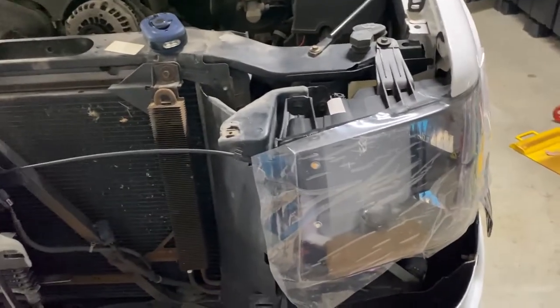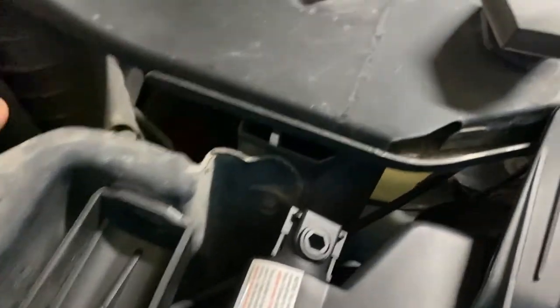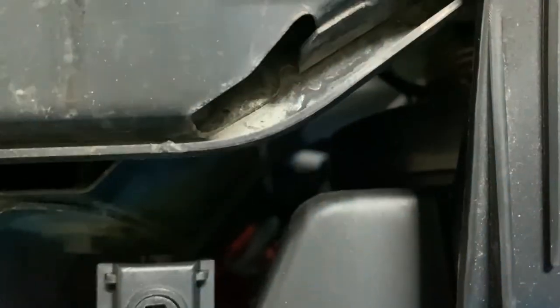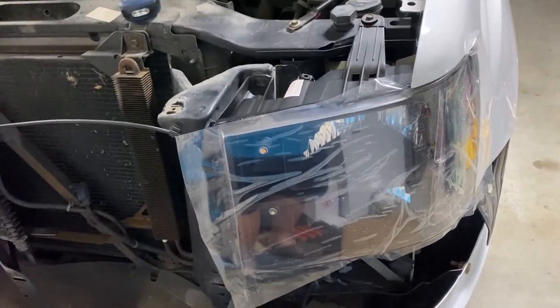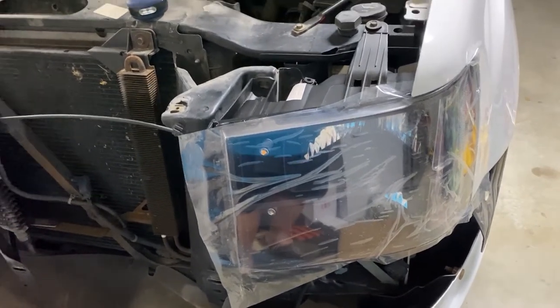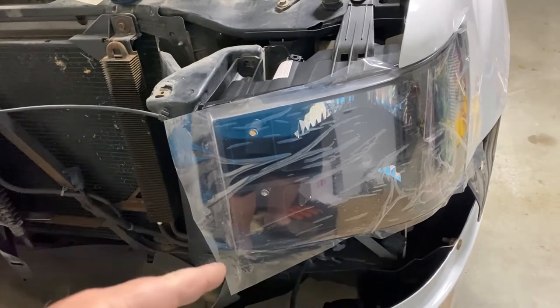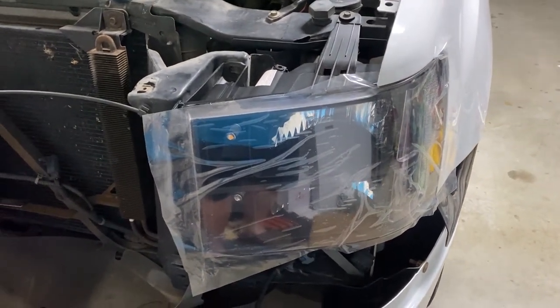I've got this in — it did not hyperflash. Before I do anything else, I mount my headlight in and then I look because I need a place to mount my resistors far away from anything. There's plenty of room down in there on this sidebar to mount the resistors. Another good benefit of doing this is hooking your headlights up before you even mount your resistors, then making sure you don't have hyperflash on either one of the lights. Because once you turn this second light on, you may have hyperflash. Always double-check your lights to make sure you're not going to get the hyperflash.